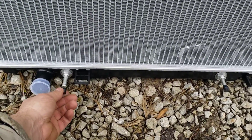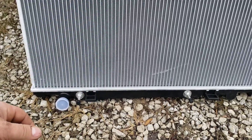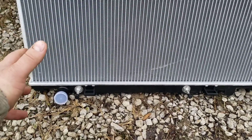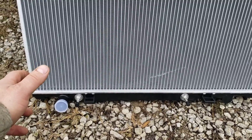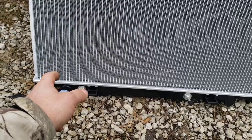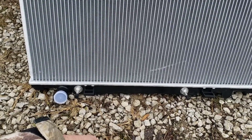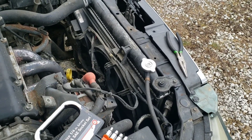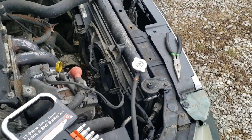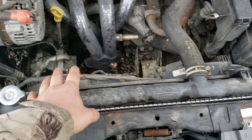Sometimes there are oil coolers for the engine oil. I've actually seen both before, where the radiator did not only coolant for the engine, but oil for the engine and transmission lines — so those were a real nightmare. You're going to have to detach the cooling fans on the back of the radiator to transfer to the new one, which obviously means you're going to have to move this pipe to pull it out.